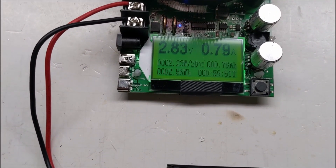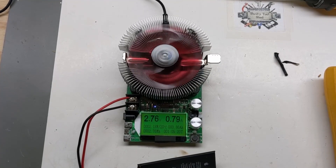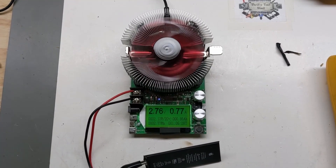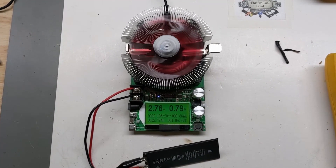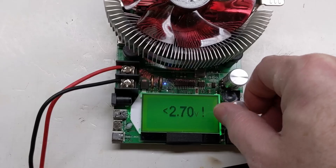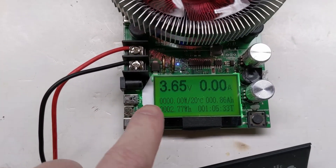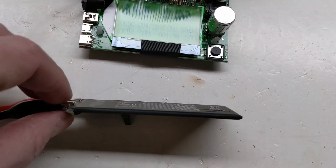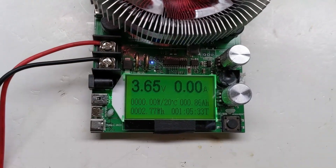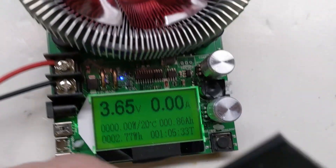Back now — it's been close to an hour. It's not going to make it even close to half capacity, unfortunately. Kind of as expected. We're not quite at 3 watt hours and we're already dropping below 3 volts, so it's not going to be long — the test is going to be over. We do see at the end how it drops off fairly quickly. And there we go. Cut the current down. You see how it bounced back really, really quickly. The battery is not warm and it's not swollen, as you can see — it's not a swollen pack. I just thought it would be interesting to do a quick test on it. I've always kind of wondered, when a battery starts doing that in a phone, what the capacity will be. This one in particular: 2.77 watt hours.